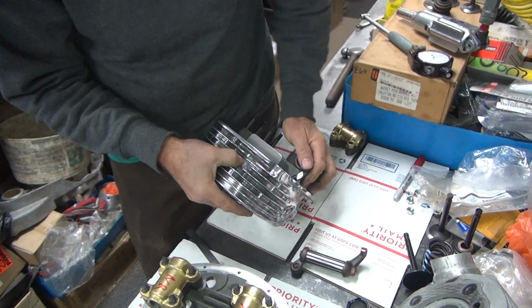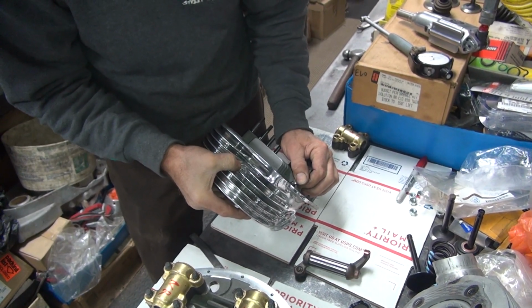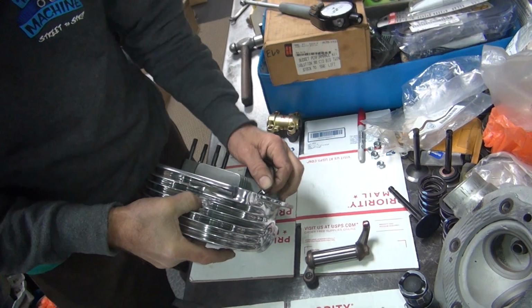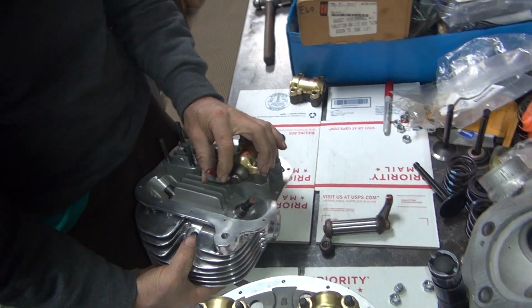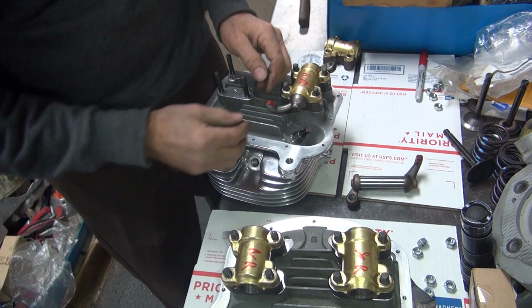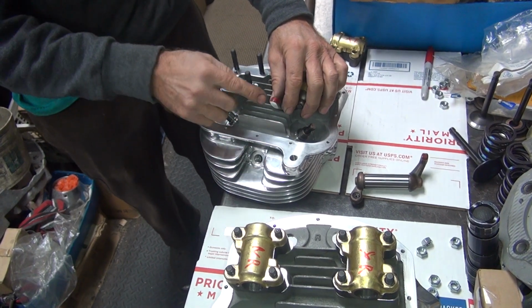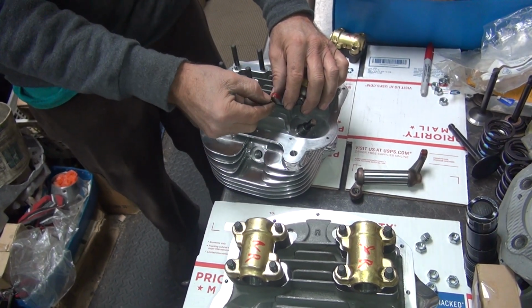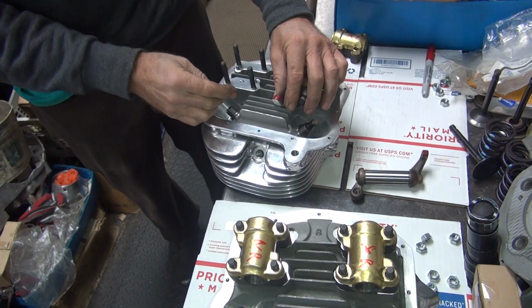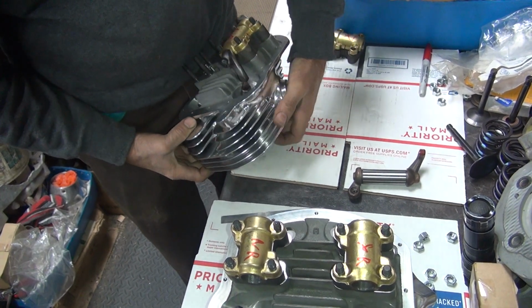See, right there's what we need to know. Need an extra hand? Nope. Okay, I see a mark now. It's the same thing I was getting. No, I have actually U going. See from here over? Yep. There's a U. It's in a high spot. So that means it's way low on this side right here. So that means my grinder's way the hell out of whack. So we need to bang it back square again to get it closer. How far off are we? That's the next question.